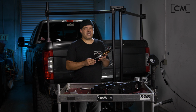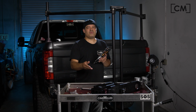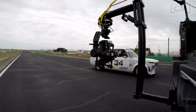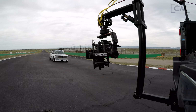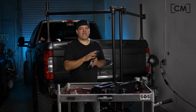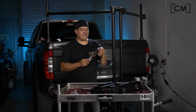And this is the kind of thing you expect from any high-end suspension system on any sort of sports car like a Ferrari, on any off-road race truck. You have all of these adjustments, because in very complex, very active, dynamic suspension environments, you actually do need this extra level of fine-tuning and adjustment. And going back to where I started, the most important thing is that these damping adjustments that you put into the system maintain a consistent result throughout the use of the shock.